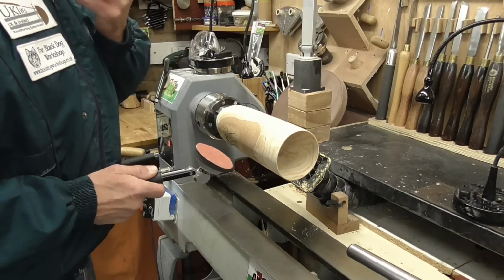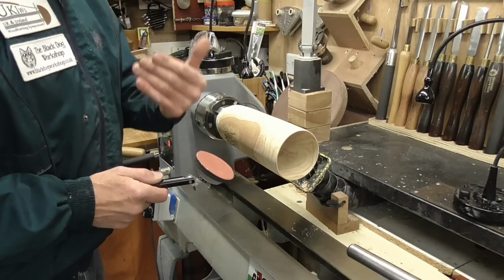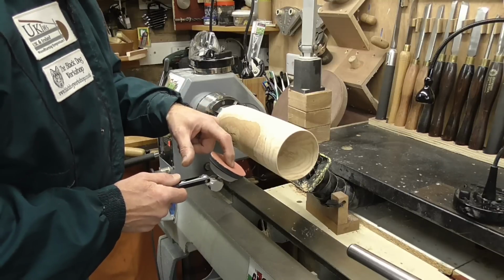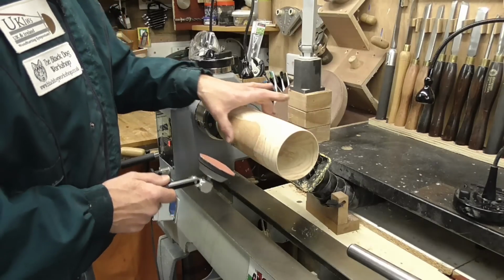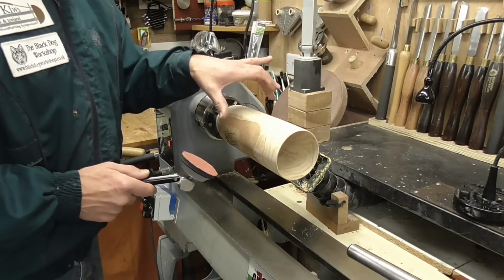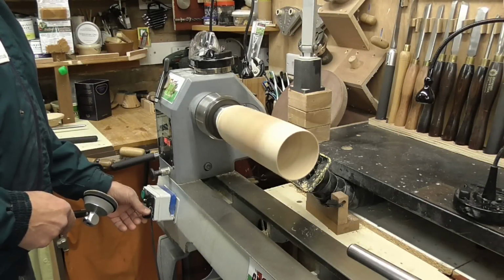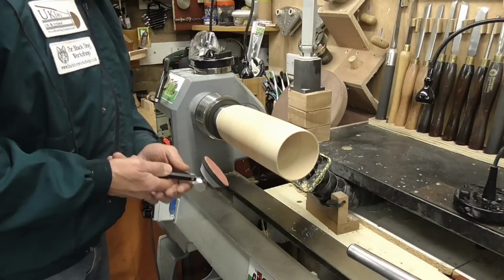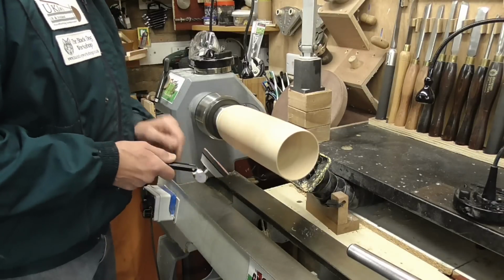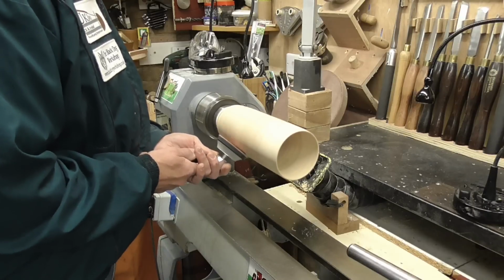Now the beauty of this is when you get to your final 600 grit, almost like sanding in reverse, if you put the pressure on the other side of the pad, it will turn the other way, and then you'll be sanding almost in reverse, and that will get rid of any visible marks whatsoever. Spin him up. And like Simon, I find it better with the handle slightly up. Okay, hold the head with your hand there, slide on underneath, and get it spinning, and go.